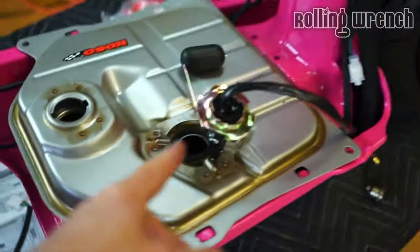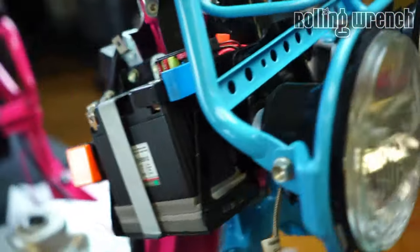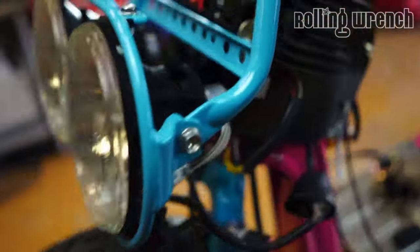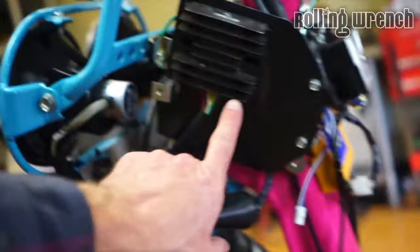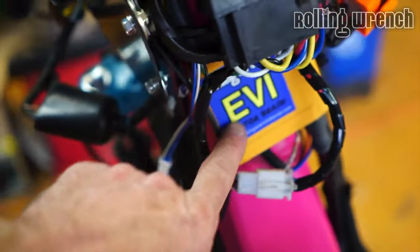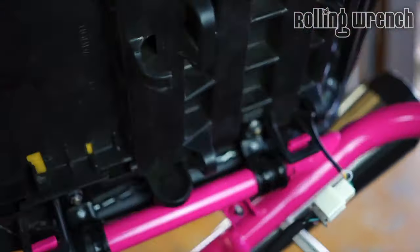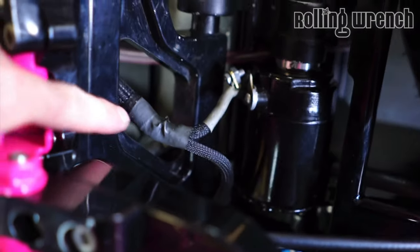New day. I spent probably 3.5 hours wiring this harness up, doing all kinds of little things just to make it work the way that I want it to work. Now I'm to the point where I need to do the fuel. I didn't film a lot of this because it's very intricate wiring that's not going to serve a purpose on film. But I've got the lights wired up. I got the carbon fiber plate on with the rectifier. Everything's wired up. I made everything kind of nice. Mounted this guy here. I got rid of the Chinese AC CDI and installed my DC CDI. It runs down and goes into the motor there. Got the tail light wired in, along with the starter and all that stuff.